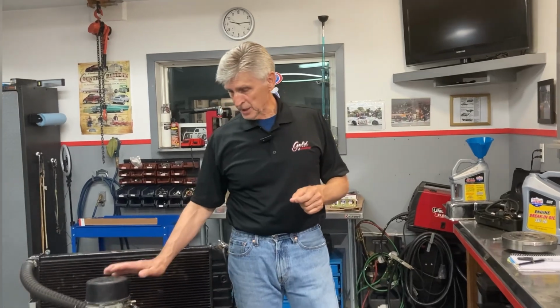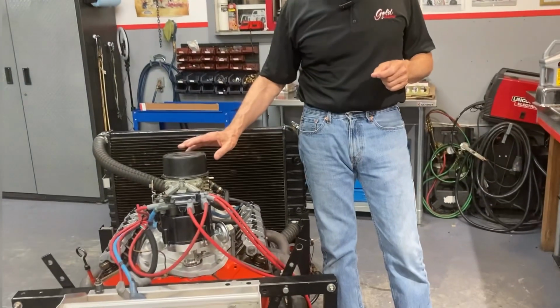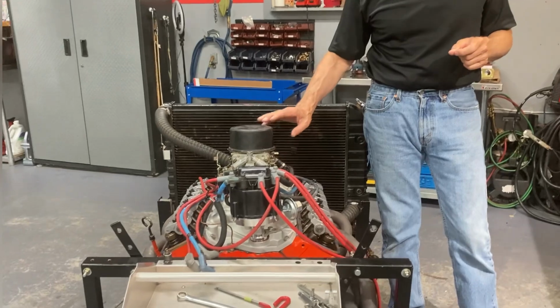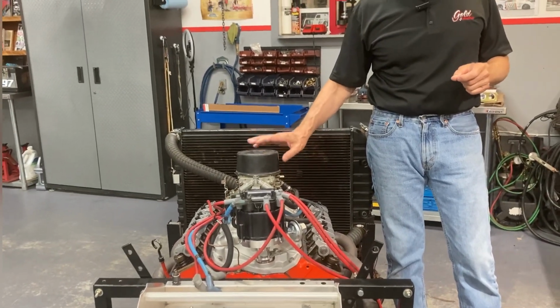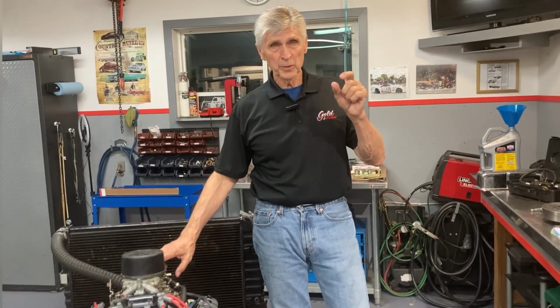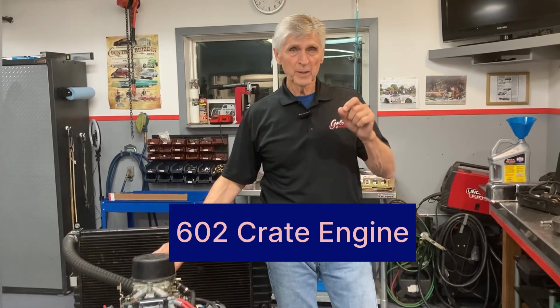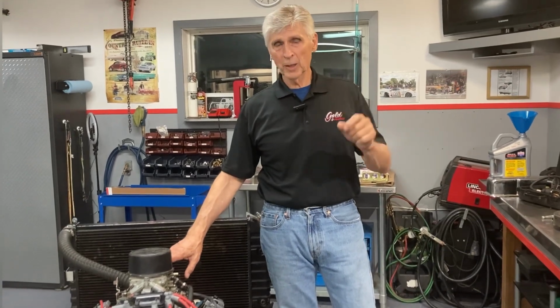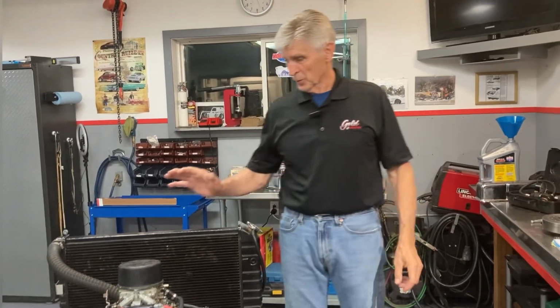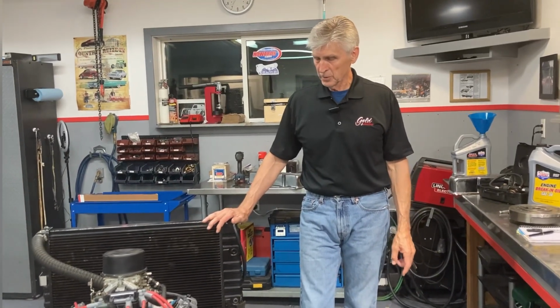This other carburetor is my 650 double pumper Holley. I've had this for about 50 years, and believe it or not, it still works pretty good. I've used it on the dyno before. We're going to compare the 650 Holley to the 500 CFM 2-barrel, and don't be surprised if they're very, very close. You'd be amazed how much power we get from that 604 crate engine that's only got 9-to-1 compression, a smaller cam than this, and iron heads. You'd be surprised how much power it can make with a 2-barrel carburetor. So we're going to find out when we get to the dyno. I forget the name of the subscriber that asked me to do that, but I'm going to answer your question, and we're going to try to do that when we get to the dyno.